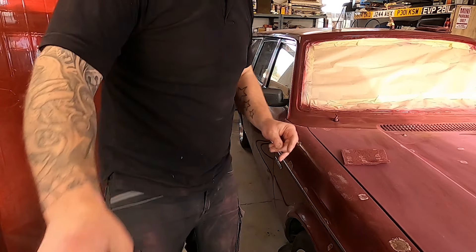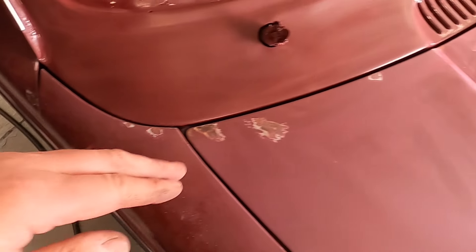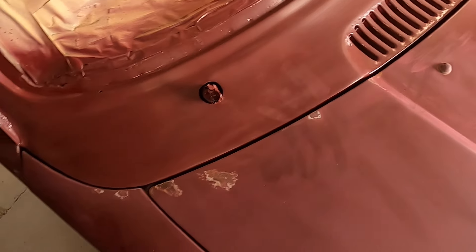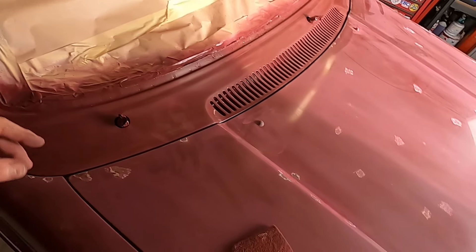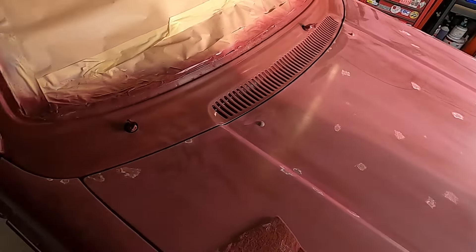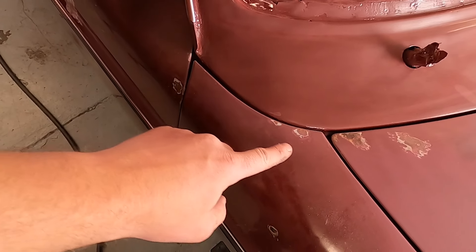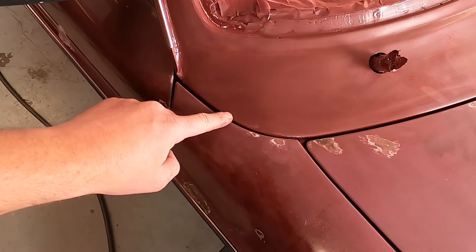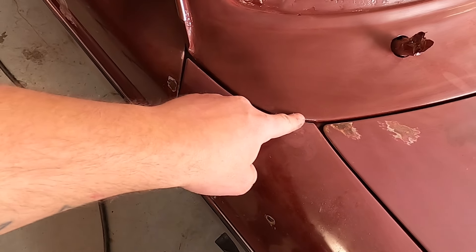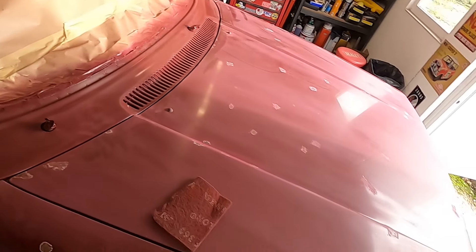Here's an example — the top of the wing I haven't sanded yet, but you can see the colour is pretty much bang on where I want it. We'll degrease the car and get the whole thing keyed, and just nib in all these bits to make them go orange again because there's dust over them now. There's a little divot defect on the top of this wing — I'll probably sand through to correspond that, make it look like it's meant to be there. I'll get a slightly bigger sandpaper on that.